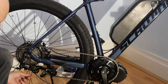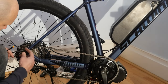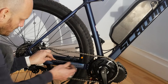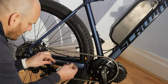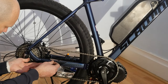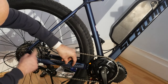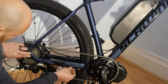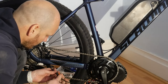Put another ferrule cap on the end — that's how you do it. For cable management, find a wire route to hug this tube and just zip tie it all the way through. Make sure it doesn't hit the chain, the chain ring, or the tire. Try to get it snug either on the very top or the very bottom — probably the bottom so you don't see it. Hug the frame lines so it doesn't stick out. If you have extra lines sticking out it draws attention that this is a homemade bike, but if you keep it along the frame it doesn't look so bad. It's an art form — I recommend spending a little more time on it because it definitely makes it look better.